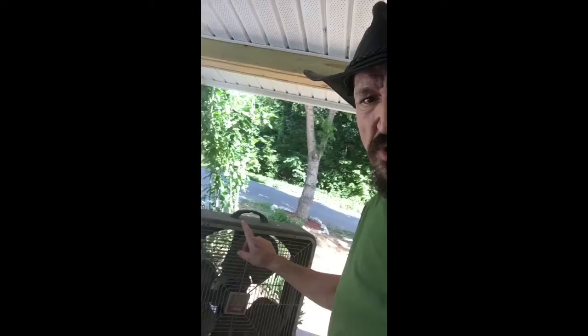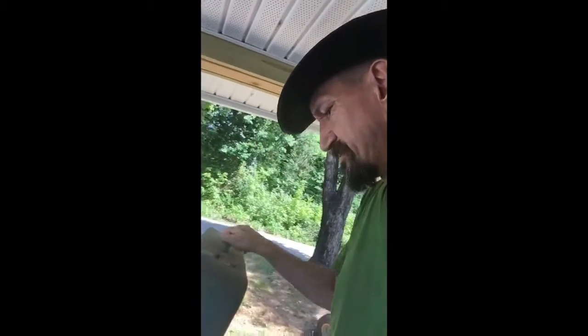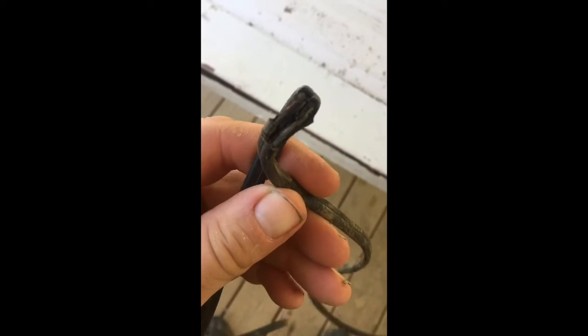What we gotta do is pull off this guard — the shroud. Once we get the shroud pulled off, we gotta get all the dust and debris out of there. You see our cord here goes off into the unit, comes up in here, goes right along the wall over here to the switch, and terminates at the switch. One of the things we're gonna do is come down with this cord here — we can see where there's some burnt stuff.